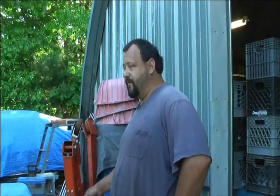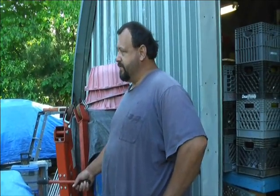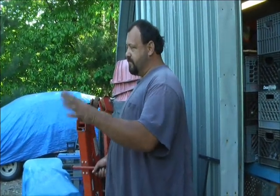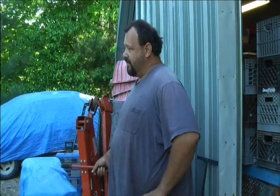It's just like you got to make everything. Everything has to be modified. The only thing that fit great was them mounts. That was perfect, because it's made for that. You think getting the motor in is the hard part, but getting the motor in, that's just pie. The rest of it is the problem. Making everything work, everything hits, everything touches. It'd be fine if you got the motor sitting there and threw your headers on it and got exhaust put on it, and, you know, $400 or $500 on the install, you'd be all right. Whatever. Buy an MSD small distributor, drop right in.